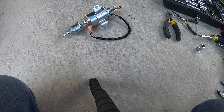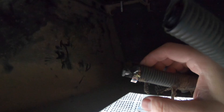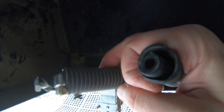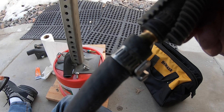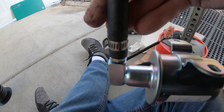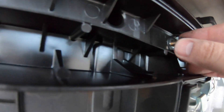The fuel pump is ready to go. On the existing fuel hoses, they had bolts and hose clamps sealing them off since it ran on propane. One is a return/vent line and the other is the actual draw line. I blew air into one and could hear it blowing bubbles in the tank — that's the bottom line. The other had no bubbles, so that one goes to the top of the tank. I extended the fuel line a bit so it won't be too tight, added the fuel filter, fuel pump, and threaded the fuel line and electrical wires up through the hole before installing — there's no way to reach the hose clamp once it's up inside.